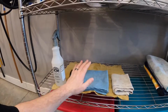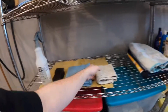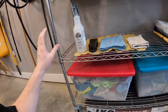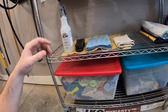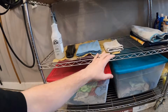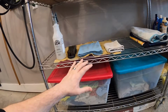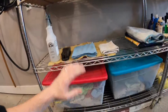The next thing you're going to need is some microfiber rags. I have 2 of them here because I'm probably going to go through both of them. And then just get another separate microfiber towel or a terry cloth rag or whatever. This is what I'm going to use, because when you're cleaning your door panel, you're spraying the product over everything on it, and once you're done cleaning it, you're going to want to wipe off any shinier surfaces like your chrome door handle. A lot of times door handles are done in chrome, so when you're done wiping everything off, you'll see a little bit of a film on chrome surfaces. That's why I use a secondary towel to wipe that film off.